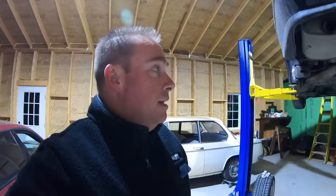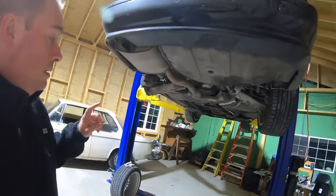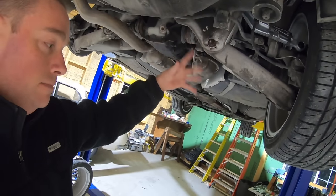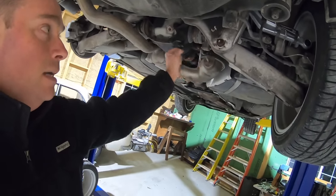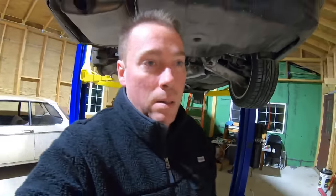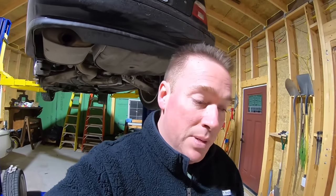That's pretty much everything to show on this car. We're going to put the wheel back on. We torqued all these down with the ratchet and then the wrench snugged them up — held that side with the wrench and ran it down with the impact. The impact on low is about 65–70 foot-pounds, which should be plenty for that. A lot of guys put them down at 100.